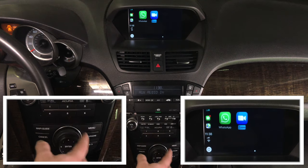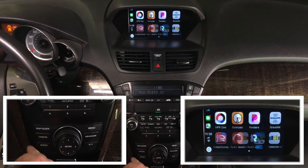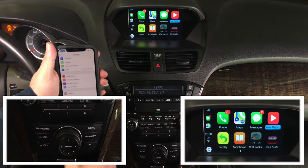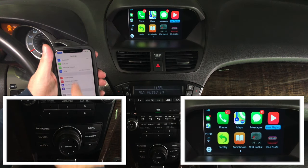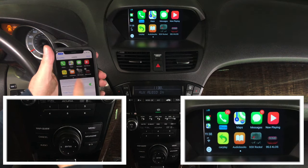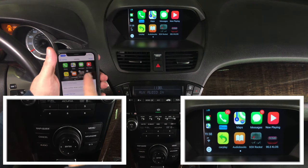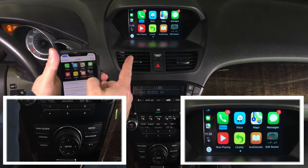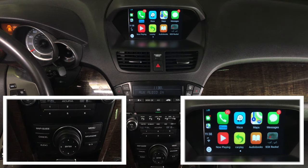Just like in a 2019 Acura MDX, you got different settings. One thing you can do to rearrange applications is go into your phone settings, go into General, go into CarPlay, and inside CarPlay you can rearrange apps. For example, I want to bring Waze to the front — I find my Waze app, drag it to the first page, right next to phone calling. Now Waze is right here on display.